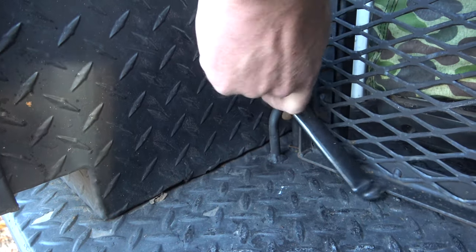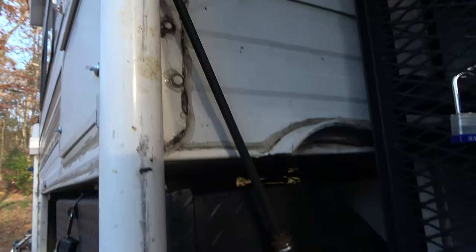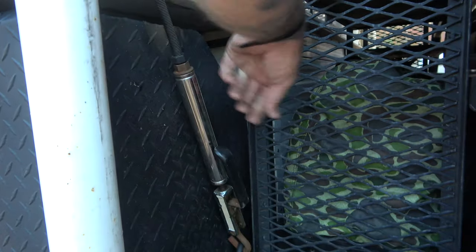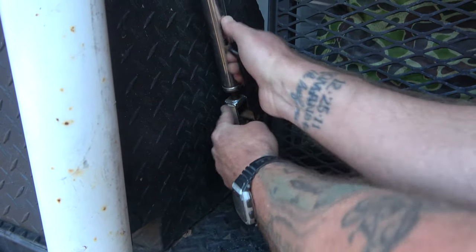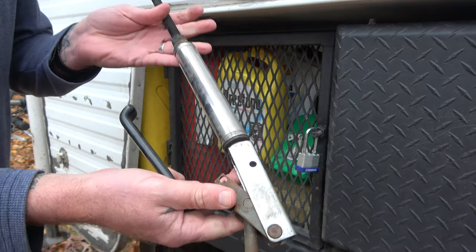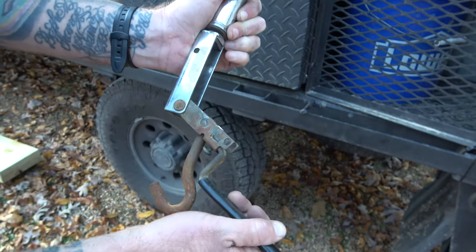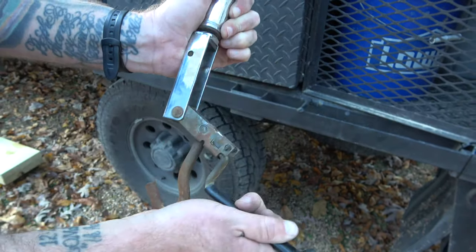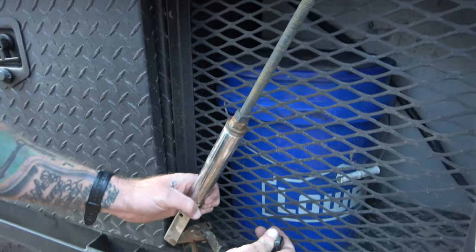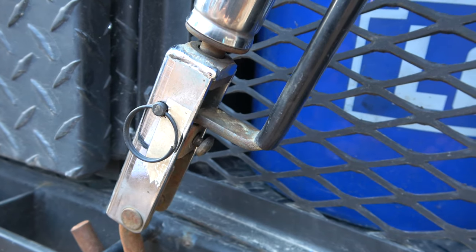Now you're going to secure the tie-downs and turnbuckles between the truck and the camper. Note that most standard truck beds will secure the camper to frame-mounted tie-downs, but in our setup with our flatbed truck camper, we secure our camper directly to the flatbed itself. Every tie-down and turnbuckle system is slightly different. We use spring-loaded Happy Jack Quick Load turnbuckles, which are great for quick release when connecting and disconnecting the camper. Note that if you're using these, you want to check the manual to see how far apart the spring-loaded portion should be from the hooks.